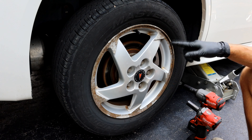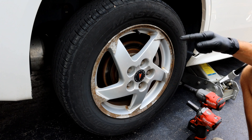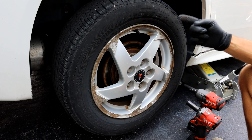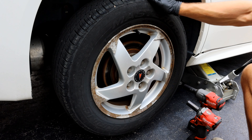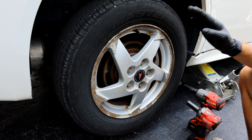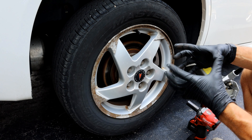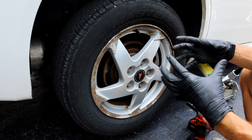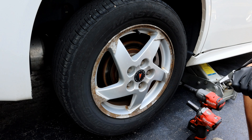If you're not sure if your wheel bearing is bad, nine times out of ten when one of these goes bad, when you're driving down the road, you'll hear it howling as the wheel rotates on the interstate. On this scenario here, it does that a little bit, but it also has a lot of movement. This is another way where you can tell that this hub and this wheel bearing is going bad. On most cars nowadays, the wheel bearing and the hub are compressed together in one unit, so you replace the unit as one unit.